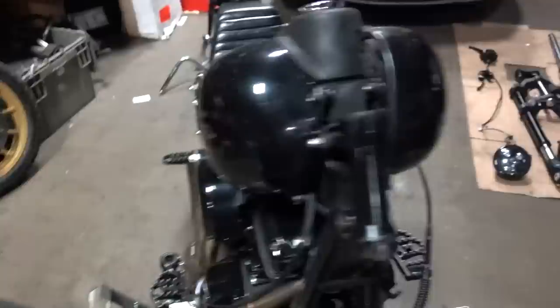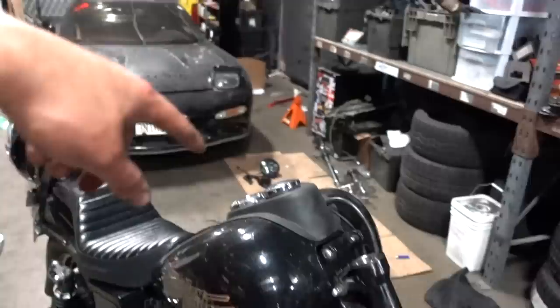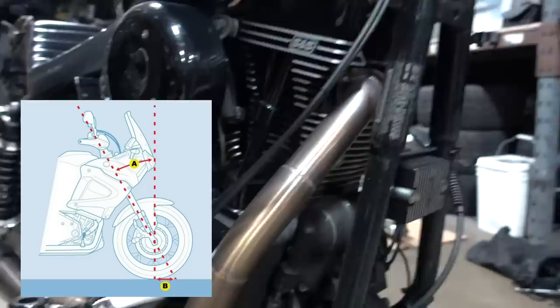We got the old front end off — didn't take too long, probably 30 minutes, mostly because stuff was crowded on there. Looking at the side-by-side length comparison, you can see just the difference in length of these forks. Just the fork alone is about as tall as the six-inch risers on it, so the bike's going to be much lower now and handle a hell of a lot better. Anytime you increase the length of your front forks without modifying the frame's neck height and rake angle, you increase the bike's center of gravity height, which changes the trail distance and drastically affects handling characteristics.